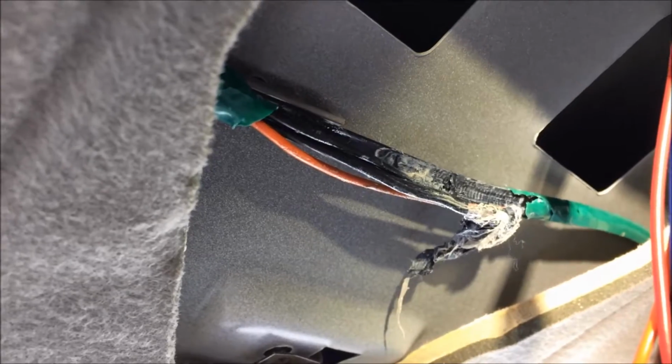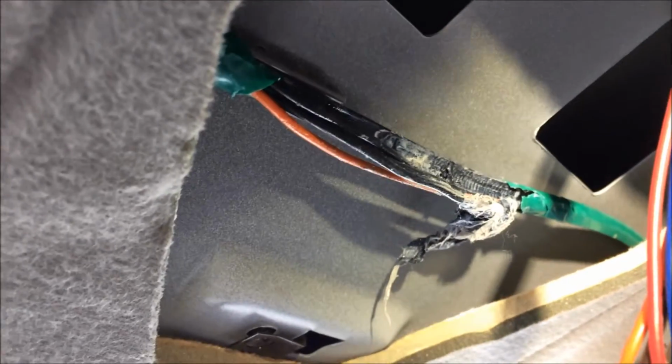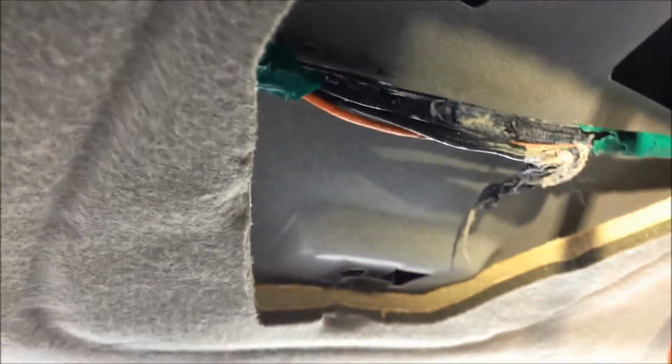I'm going to go see what I can find in my manual's electrical diagrams and see if maybe it'll tell me which ones are which up here, and then I know exactly what I'm wiring into. I mean, all I need here is an orange and a brown, and that's an orange, and I'm guessing that's all that is here. I bet if I pulled off that A-pillar trim, all I'd find in there is just the orange and the black, or the orange and the brown, whatever.